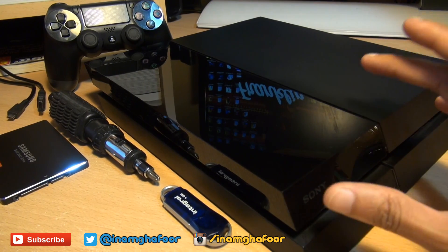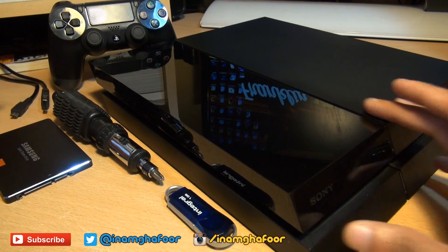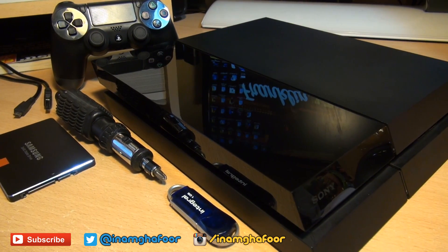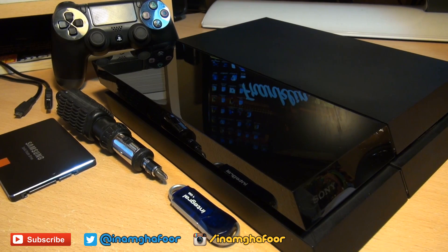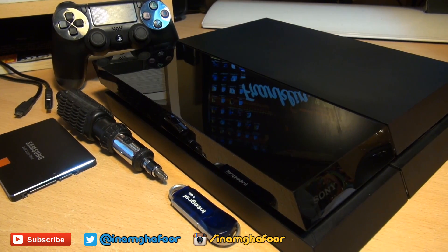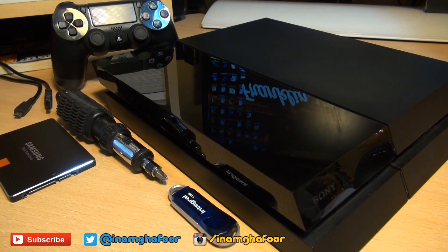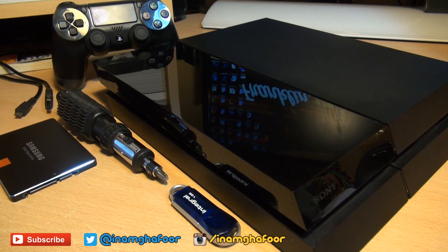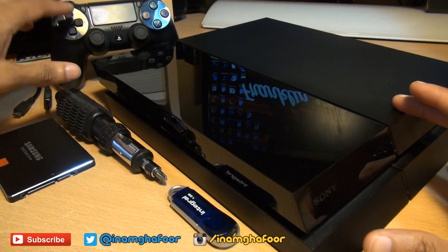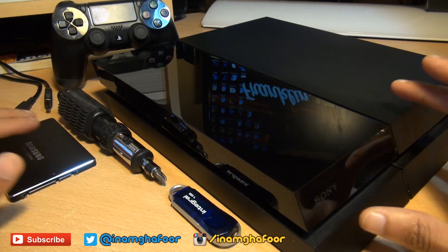For this you're going to need the console unit itself, the PS4 controller, and the USB sync cable that came with it. Because as we're removing the hard disk drive — which is the brains of the machine, housing all the music, movies, pictures, and game data — none of that information is automatically transferred to your new drive. So please make sure you backup all the important information you need before removing your old drive, and subsequently we'll need to re-pair the controller with the console once the new drive has been placed in the unit.